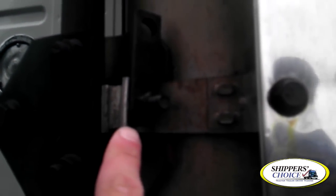I'm going to check my exhaust mounting bracket — it's not cracked, bent, or broken, all screws and hardware are present. I'm going to check my exhaust — I see no black soot that would indicate any cracks or holes. And my clamps — not cracked, bent, or broken, all bolts are present, and it's secured to the vehicle.